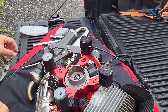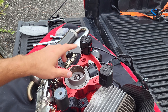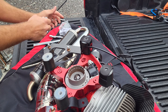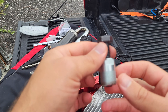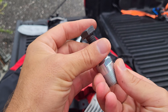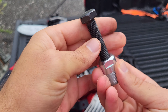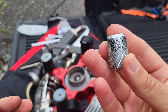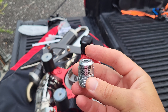I can see the wave washer inside — we're actually going to leave it there for the next step. Now we are going to need your flywheel puller, which is comprised of these two parts here. You're going to want to take the black part out first — this will screw in later. I can list the part numbers that you can get these from Sky Sports USA as well.